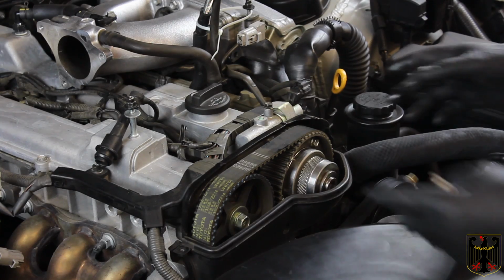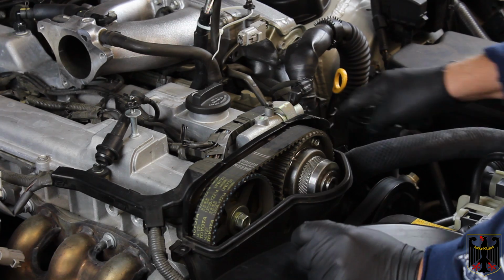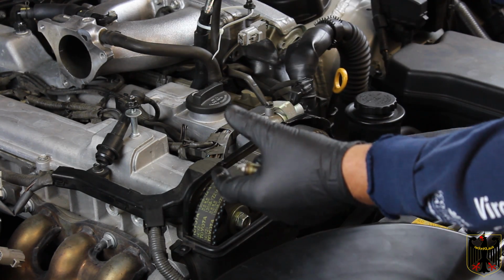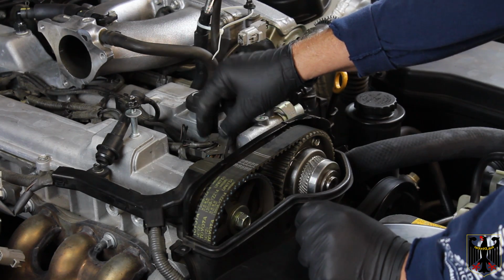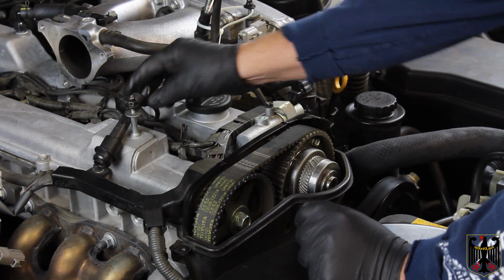At this point, we took a 5mm Allen wrench and we took the timing cover off. There was 4 bolts that held it into place. And so that came off no problem. And then we went ahead and, since we have access here now, we pulled the number 1 plug out. So we pulled it loose.